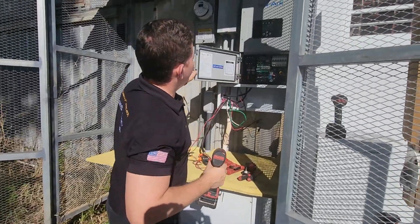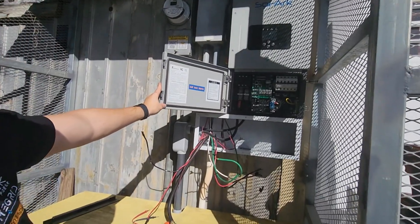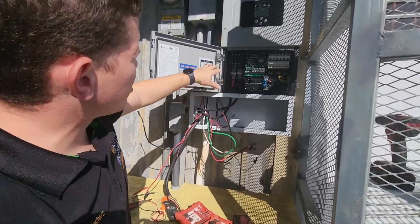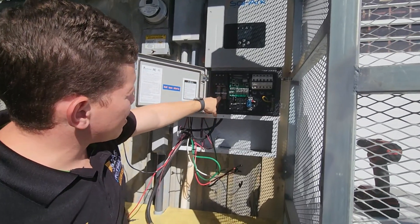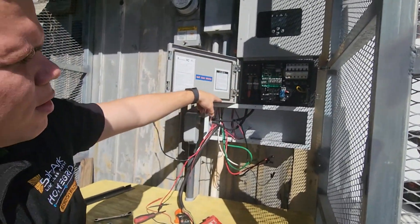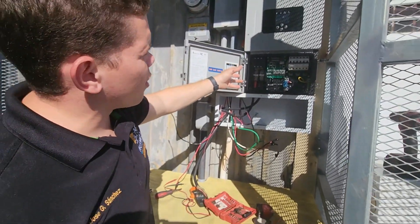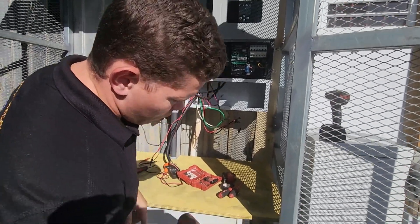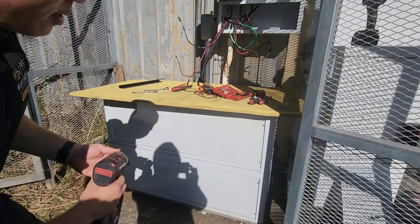We took off everything except the battery. The battery does not have a disconnect down there, it is just this disconnect right here, so if we take those off they can spark. They are not going to spark if they don't touch each other, but it can happen. So we're going to take off one cable from the battery down here.